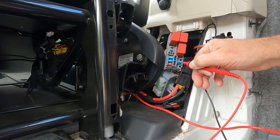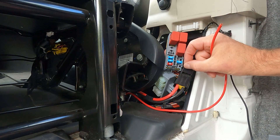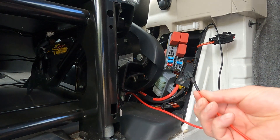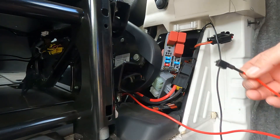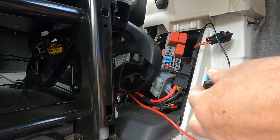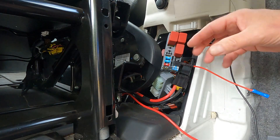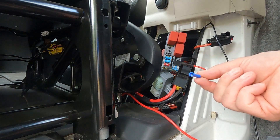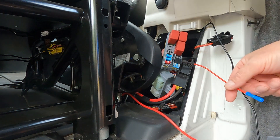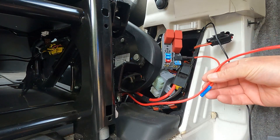These points here and here — where this fuse is, I was hoping I could find the clip to put onto the end of this wire to clip it into the back of this unit and bridge across with another fuse, but I can't seem to find those clips available. So what I'm going to do just for speed is use this little thing here called a piggyback. The way a piggyback works is you remove the existing fuse that's in place, locate that into the piggyback, and pop the piggyback where the fuse came from — that maintains the previous existing circuit.